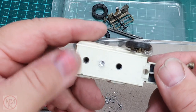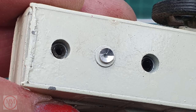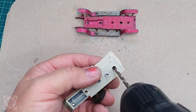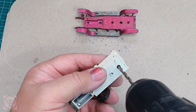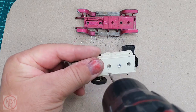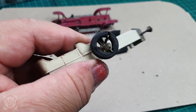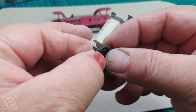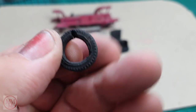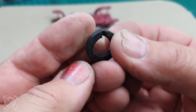Those seats, as I said before, are held in by two plastic rivets - they literally just fall out once you remove that little bit of plastic holding them in. There's just this handbrake lever on the side which also holds the spare tyre on, and that's got to come off. This tyre is going in the bin unfortunately - you can see why it's split, because it's held in three places by that metal piece on the side of the car, and all three points where that metal holds it are starting to split.